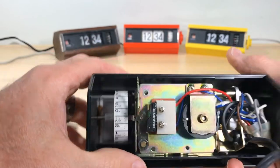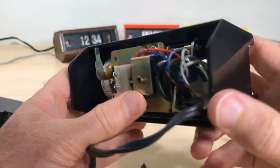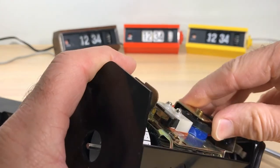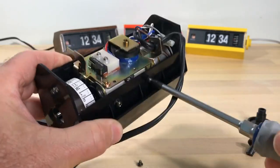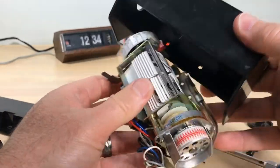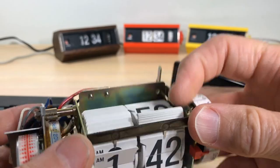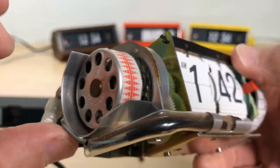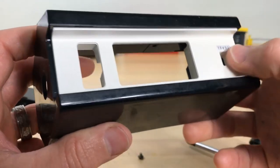Now there you can see the alarm right there, dead center. That's not working — we're going to get into that. I've never worked on one of these alarms before, so we're going to try to figure that out and see why it's not working. It's either a mechanical problem or an electrical connection problem. We just remove the two screws to get the mechanism out, then gently pull it away. The first thing we see is the flip tiles seem to be in really good condition. I've noticed that on the white-faced ones the tines don't dig into the top of the tiles as much as with the black ones. The light looks good, the motor is spinning freely — really a dust-free clock on the inside.